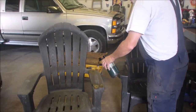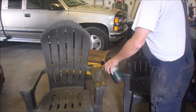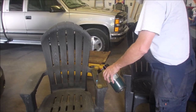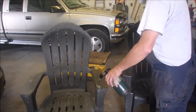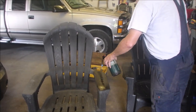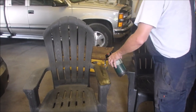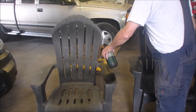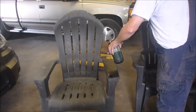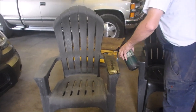Then we tried a heat gun. The heat gun was way too slow, so the blowtorch is way faster. You just keep moving it back and forth like you're spray painting something, and it just kind of melts the surface and gives it a nice sheen. It's not perfect, but one thing it does get rid of is the faded stuff had really bad, almost like a grit feel to it, because the resin has started to break down.